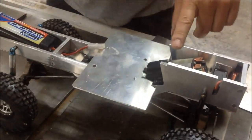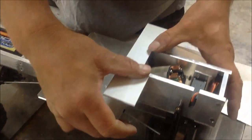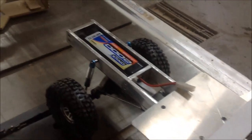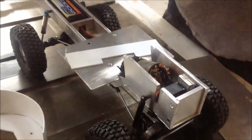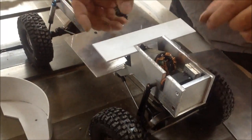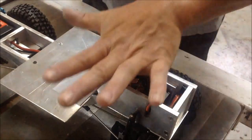Here is where I notched it out — this is where I am going to be putting my dash. Here it is — this is my bracket that I'm going to use to support my dash. When I pull it off, my dash stays with the truck. Once I'm done with my dash I'll just hook it on here, make it a little bigger, cut it out later, and then just screw it in. And that is how you do that part of the frame.